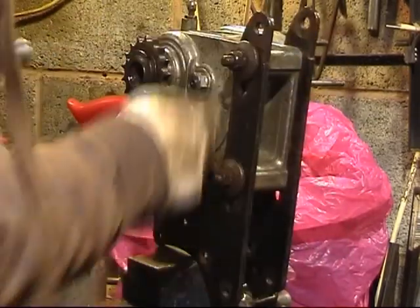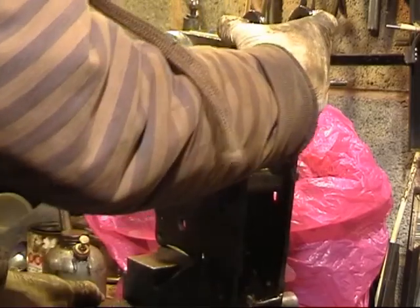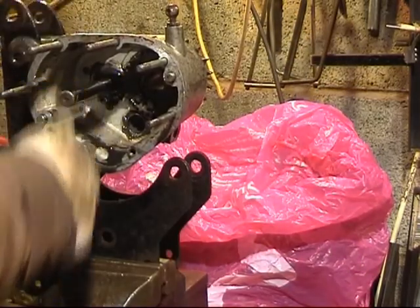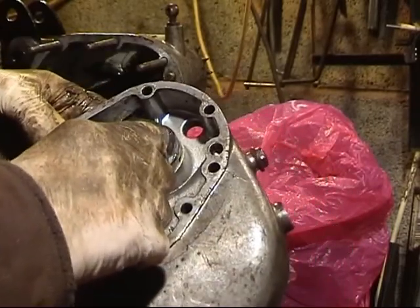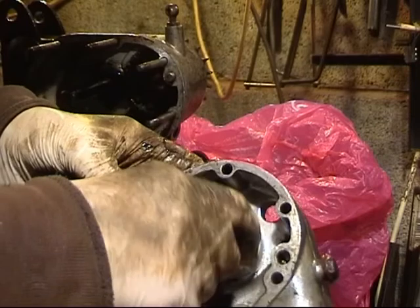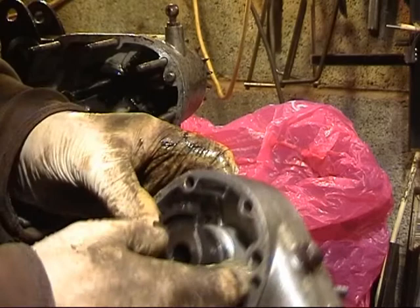There it is there. It's held by a lock nut anyway, so it shouldn't move when it's in service. But it's worth remembering that that one can cause things to bind. Back to the inner cover - the book says that the main shaft should have no play at all, which sounds a bit precarious. And the lay shaft should have 5 thou. Well, this one was nearer to 20 thou, so what I did was made a washer to go behind there.